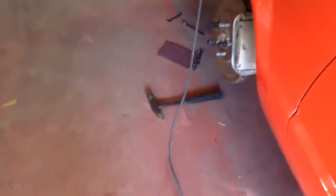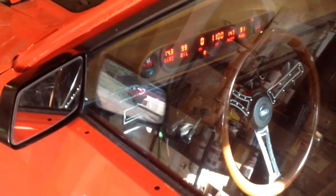We're at 142 degrees. The fast idle solenoid should have kicked off by now, but it doesn't appear that it did. It just did — fast idle solenoid just kicked down. It still says I'm idling at 1100 RPM. I'm going to find out whether this is an engine heat-related problem or something else. I still have 99 pounds of oil pressure, so clearly the oil pressure sending unit I purchased and installed is going to be one more $20 thing I have to buy over again.